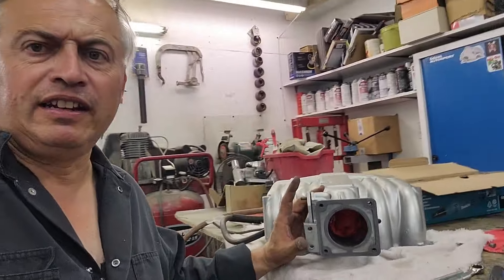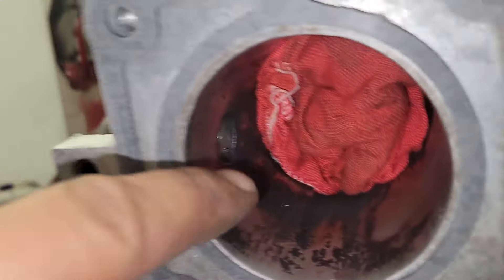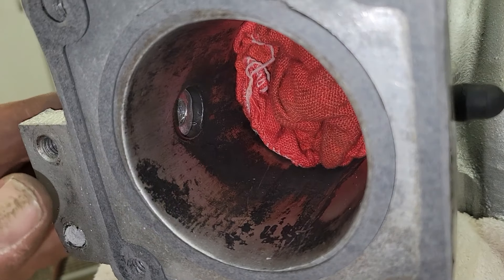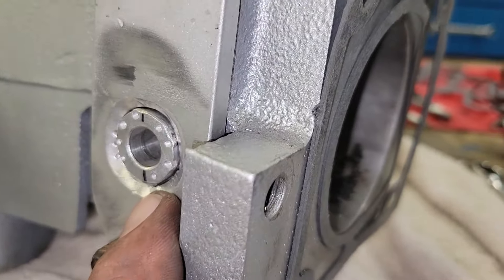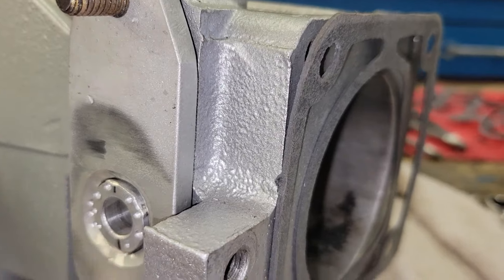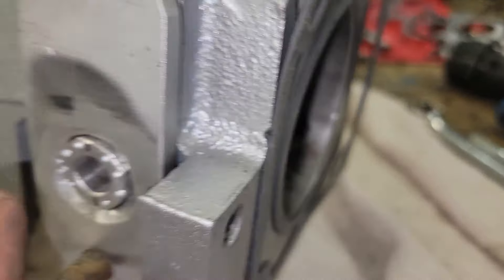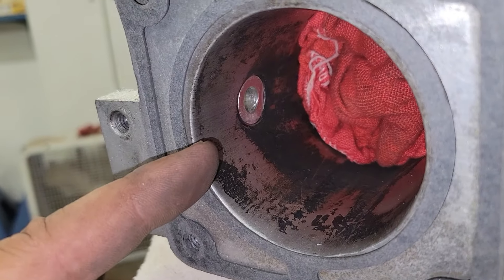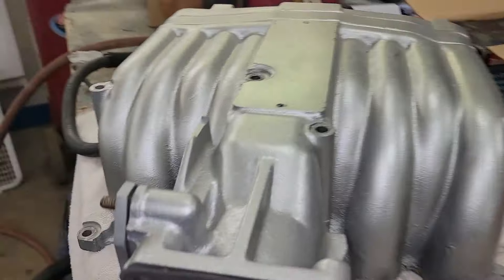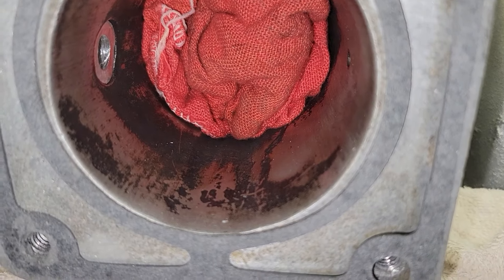The intake is off. I was originally going to radius that EGR port, but being a bit of a purist, I found an aluminum bushing that fit perfectly into that hole. I'm going to get that end welded shut, grind it flat, and get it welded on around here really well. That way we're not going to butcher this nice Saleen intake — it's a Saleen modified Cobra. I'd rather do that than radius the hole.